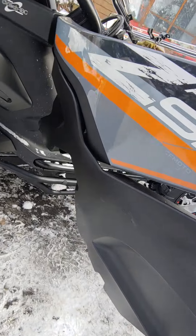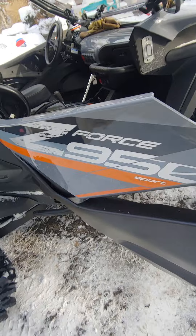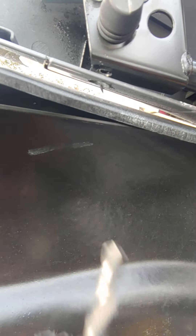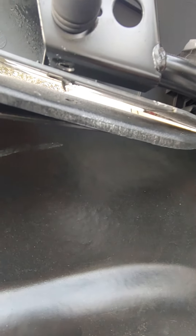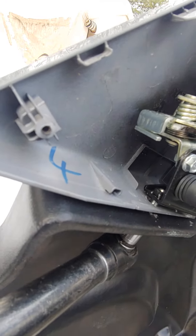The door's out a bit — perfectly normal because it doesn't take much. You pull it in and then it's going to come up. Move along to the next bolt. My last bolt, as you can see, holds back and there's just no movement in it even when loose. I had a problem on the other side — I think the product shrunk a little bit — but the bracket is good and the bracket holes line up. So that tells me the material shrunk on the door. Just take the drill and blow a new hole through it — no biggie, because you've got that reinforcement plate for strength. Just open that hole up, get your power ratchet on there, and since it's already got a nut in there, just send her home.